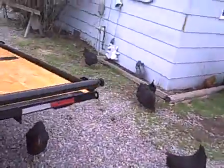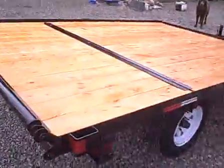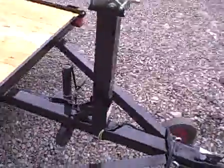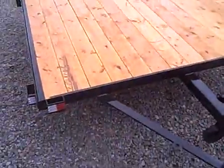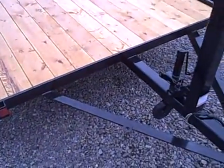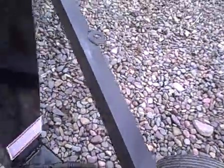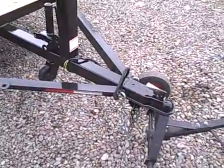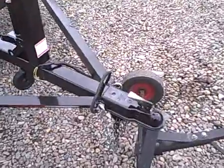Still, these are probably better than your run-of-the-mill cheap manufactured trailer. They are handcrafted here in Montana, made with wood milled at Tricon Lumber in St. Regis. It's a tri-frame tongue, just like all our trailers — even on the economy model we don't skimp on the tongue because it's such an essential part. You've got a 3/16 3-by-3 square tube, and then 2-by-3 angle A-frame on each side, also 3/16 — a little bit thicker than what you'd find on a normal trailer.